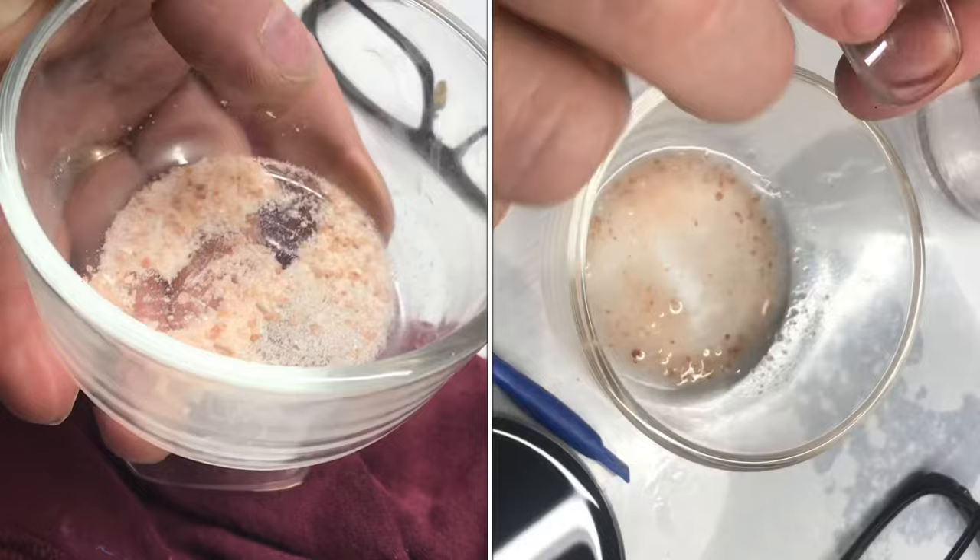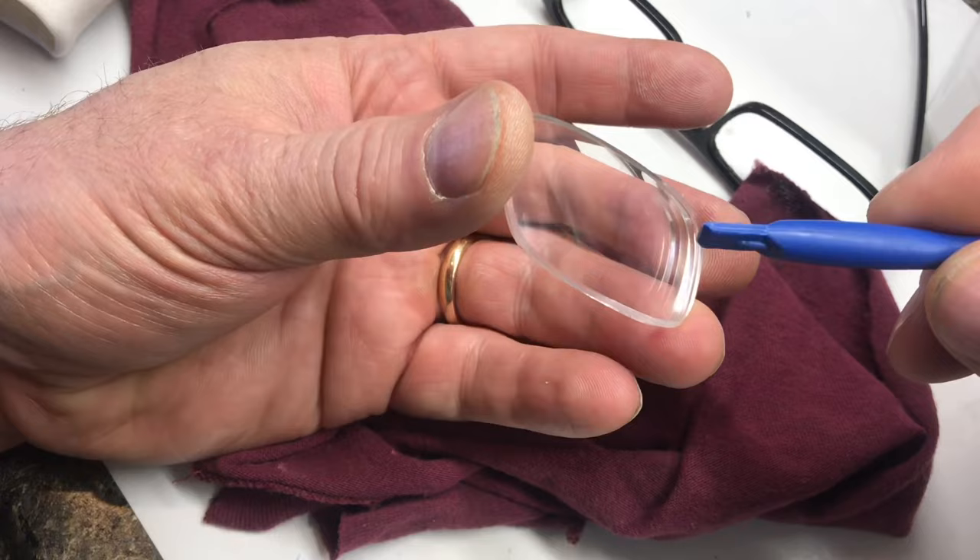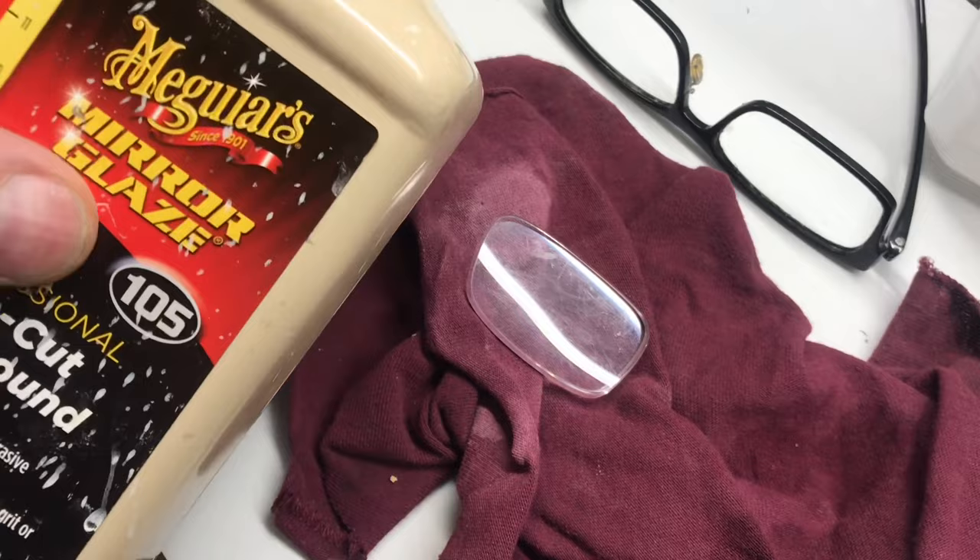When I polish up the lenses, I can see some small scratches on there. In years past, I've only used my fingernails to get this coating off. This time I used a plastic polyethylene scraper, and it's possible that did put some scratches on it. To remove some of those small scratches, I'll use some buffing compound and work it right into the lens.